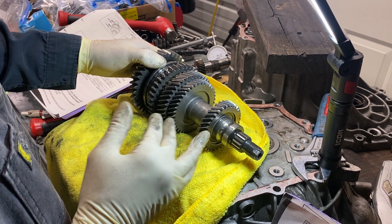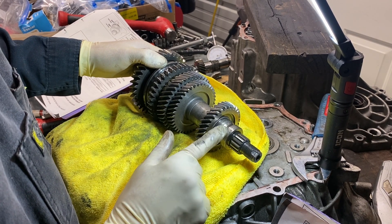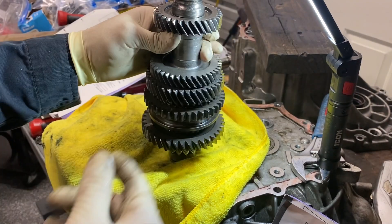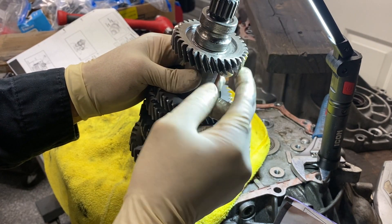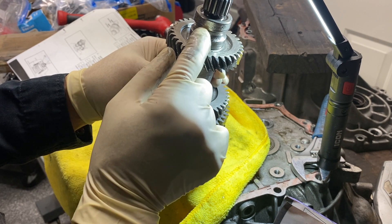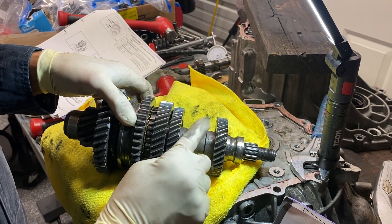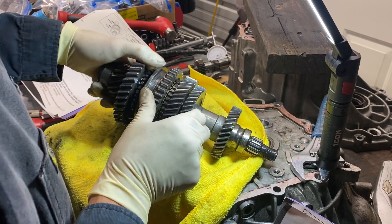On the output shaft, remember there used to be a bearing here - this bearing exploded. So this is the inner race of the bearing, and this is the fourth driven gear. What we're going to do is stick this guy into the bearing separator, support this guy right here, and push the shaft through the middle of it. That'll pop off this fourth driven gear and pop off the inner race of this radial ball bearing. And then this should be a little collar - a little spacer. So let's go set up for that.